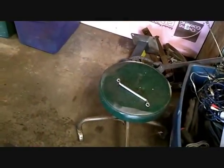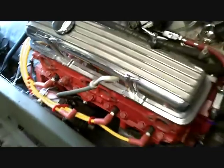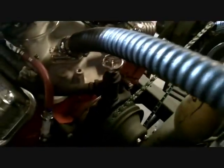I'm wiring the power to the fan now so you can see it. I'm cranking right along on the dipstick — the correct dipstick. For '86 only, I guess the hole on the block down there is smaller. I just had to bend it up a little. That's all set. The turbo hydro 400, it had come out of a box truck, and the dipstick went way the hell out — I couldn't check my oil from up here.